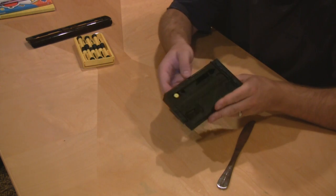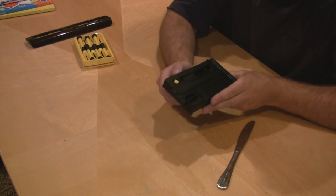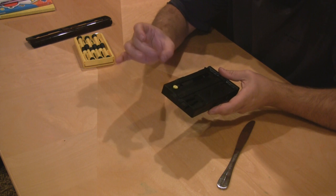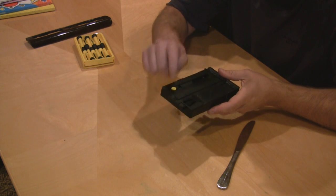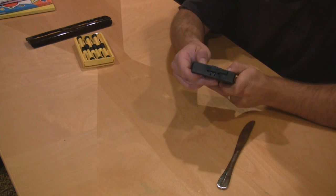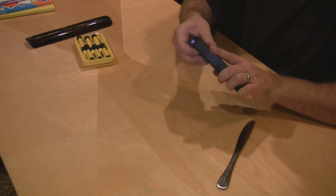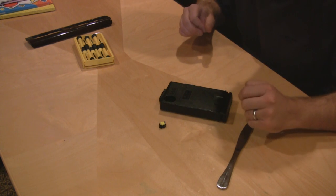To take this apart, you'll see that there's a little tiny gear on the back side here. All that gear is for is a damper — think of the classic spring and vibration damper example, where you have a coiled spring and the damper just keeps it from going too quickly. This basically just pops out; there are two little clips inside and with a little bit of pushing with your finger, it just flies right out.